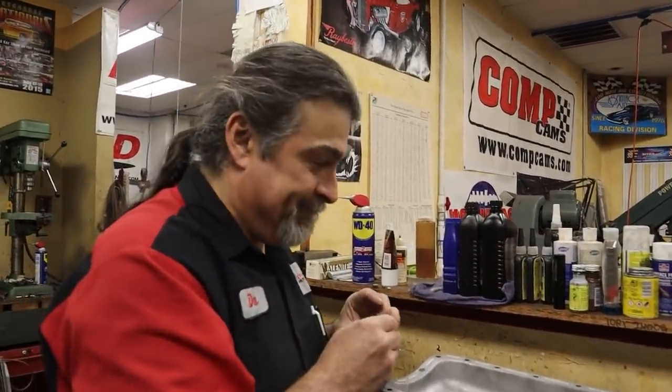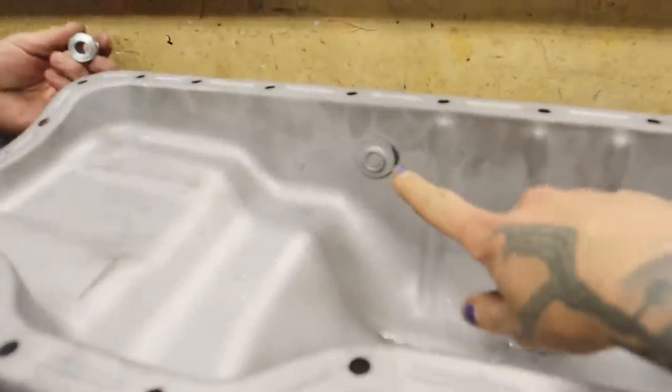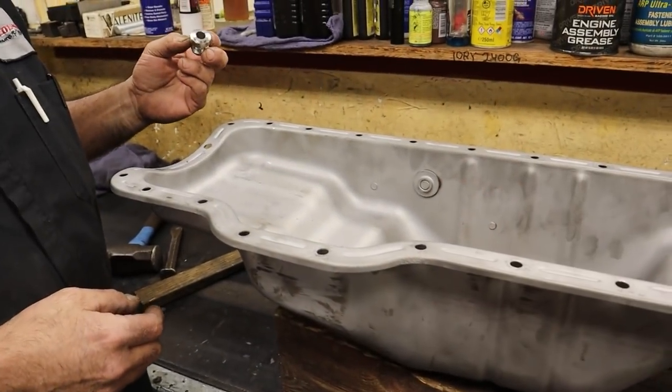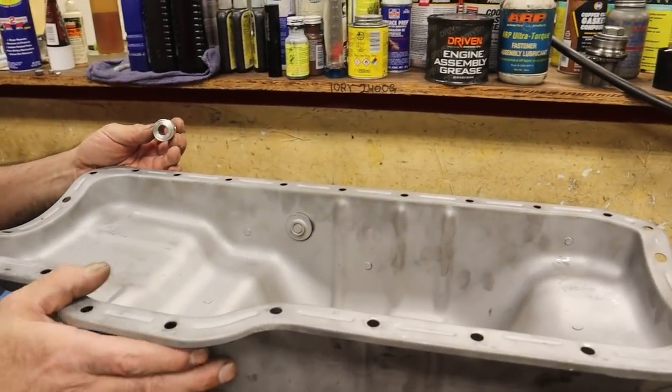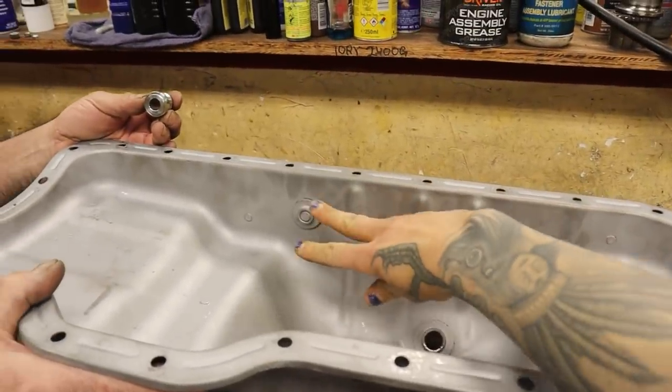It'll push it into the intake manifold. Right. And then your turbo will be smoking, and then you're like, my seals are blown. So this actually is a perfect place. Right, and we checked this already. I mean, not only does it make sense from the factory usage of this, it's already a return line, but also we checked the dipstick and just made sure where the level was going to be in the pan, and that's also above it.